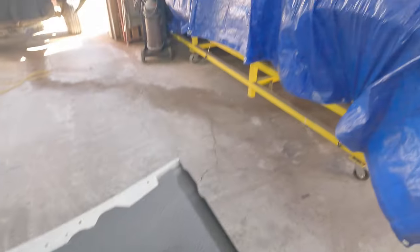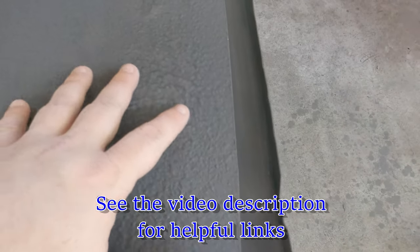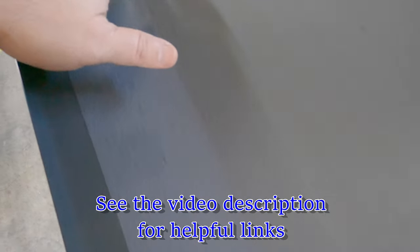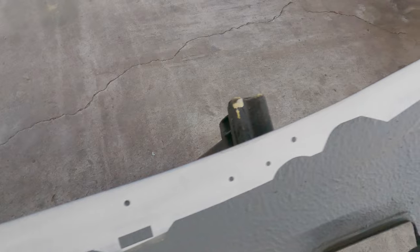Unfortunately, these stains came about from storing the doors straight on top of the car with this side up. My roof — it's not the best place but it works — was sitting right there on top of the car and some condensation got in. Drips happen. It doesn't violate the integrity, but it does stain it just a little bit. We're going to put the door over that, no big deal. Everything was treated in lizard skin and I'm going to leave a link for that product in the video. I also used some weld-through primer just up top here — I'll eventually go back over that with the epoxy coating.